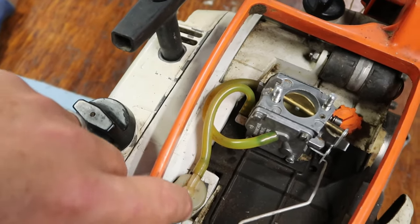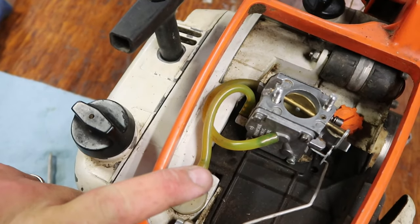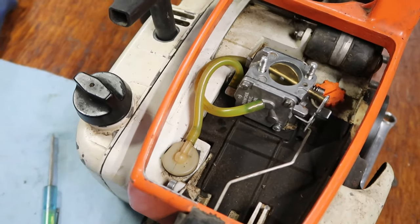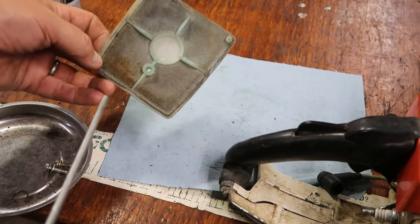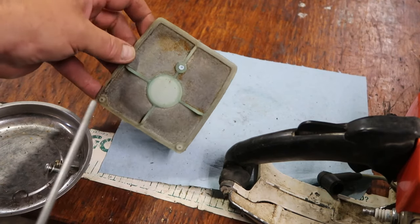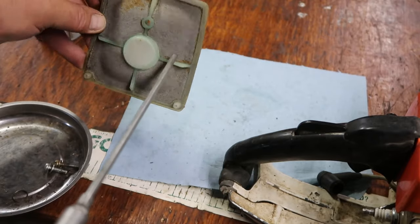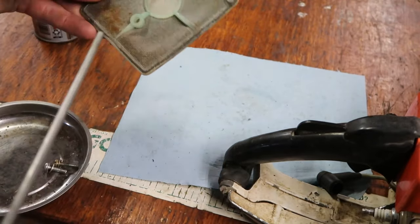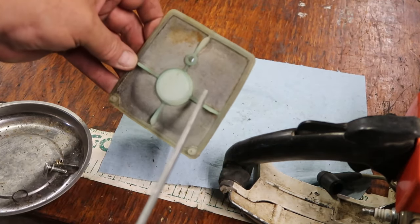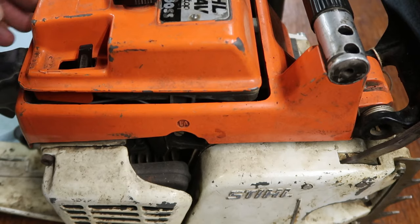There's no primer pump on this, so I'll just have to see if fuel makes its way up to the carburetor. I'll put the exterior pieces back on and take it outside to see if she cranks. While putting it back together, I check the air filter. Manufacturers will tell you to buy a new one every year — that's because they make them — but if you keep it clean it'll last a long time. Just spray it out to get the dust out, and sometimes you can even dunk it in some cleaner to really clean it.